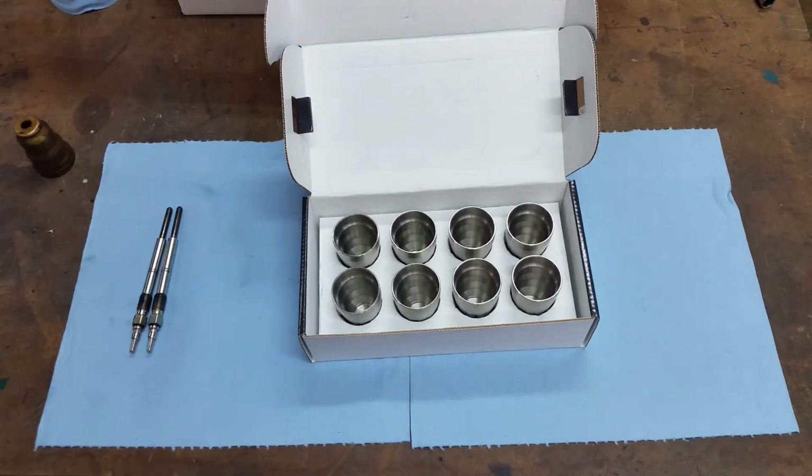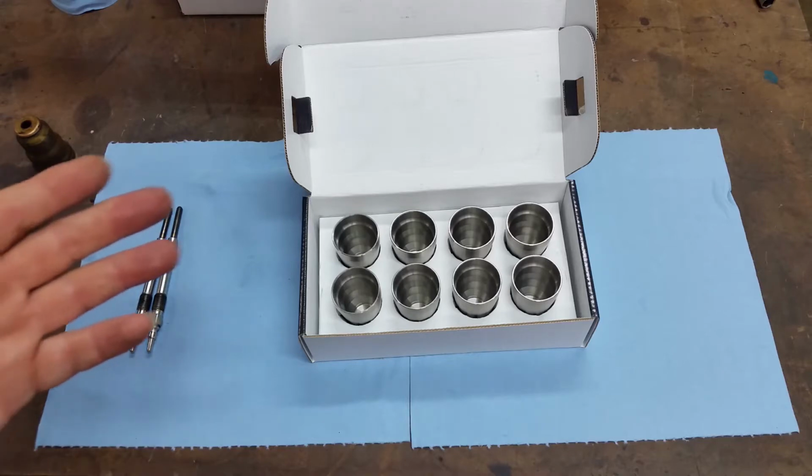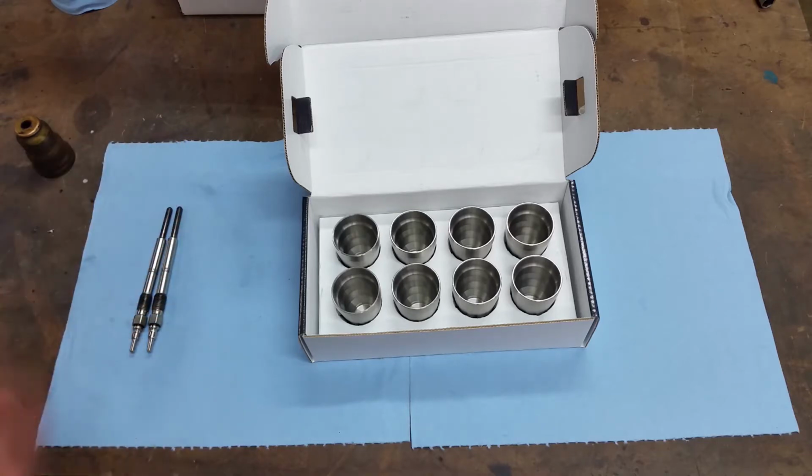It makes sense, because you've got a cast iron head. The original was a brass cup and a stainless steel injector, separated by O-rings, but still stainless steel. The brass doesn't really fit into the equation to me. I've worked on some big diesel engines, and they don't use brass for much of anything. It's either stainless steel or bearing material. Injector cups, I've always seen as stainless steel. The 7.3 is actually the first engine I've seen with the brass.